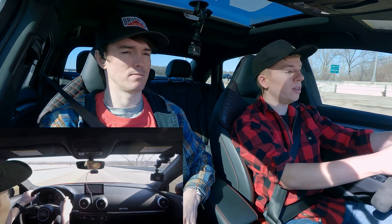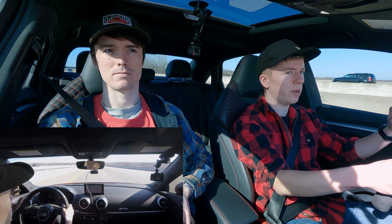Hello and welcome to Hardway Learning — we've got the ethanol content sensor in. I put in 12 gallons of E85 earlier this week and the car was running pretty rich. So that kind of was a signal that it wasn't fully E85 — I was thinking since I still had two gallons at 91 that it'd be like around 70. End of the week I ran a third of the tank out, added more E85, and it's saying that it's only 60. So that would explain why the car was running pretty rich. But this thing, it's a lot happier on corn. And the fuel mapping should be a little more accurate now that it has the actual ethanol content input.